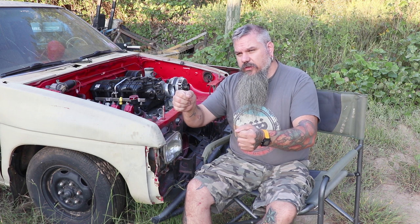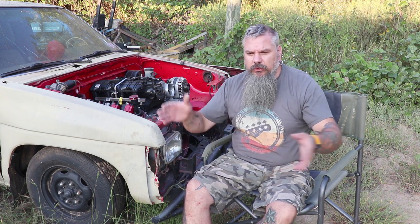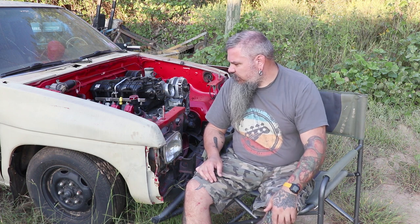We haven't done a video of the truck for a while. I was trying to get the motor and the transmission bolted together for the last time and into the truck, and I ran into some complications. Something's wrong with the transmission — it won't spin over. I put the torque converter on and it'll do 359 degrees and stop, then 359 degrees the other way and stop. So something was either already messed up or I messed something up during the unbolting and bolting. I've either got to get that fixed or get a different transmission. Do I spend money to repair and beef up the 4L60E, or spend $700 and get a 4L70E which is slightly better?